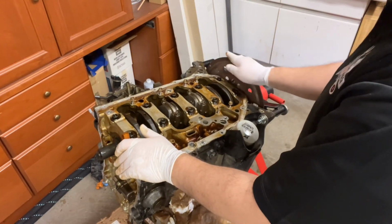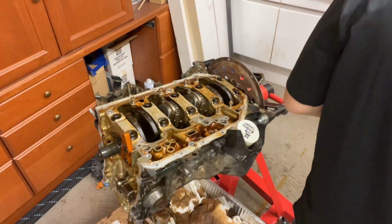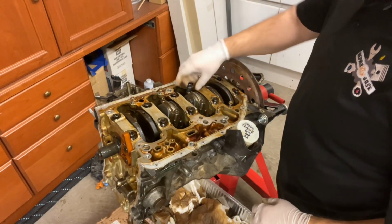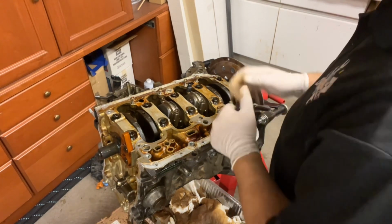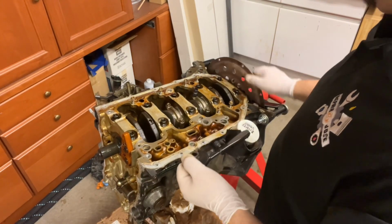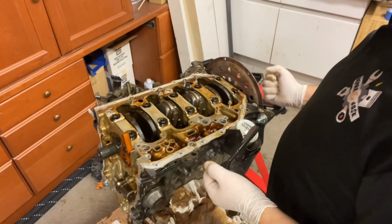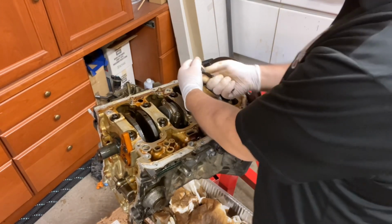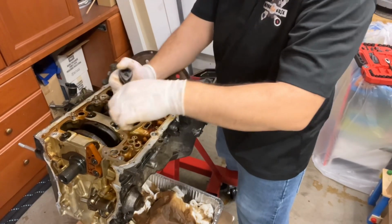Before we do that, we have to take these pistons out. These are 12 point, and I think they're 10s. Let's see. 12.10s, that's right. So we're gonna get those out. If you didn't have the flywheel with you, you will have to put the pulley back. Okay, so I have this, and I love how easy this moves. It's a little stuck because of the bolt from the mount, but even so, it moves nice and easy. This is smooth. So, like I said, this engine is bulletproof. I love these engines. So we're getting the connecting rods out, so we can push these pistons out of the way.